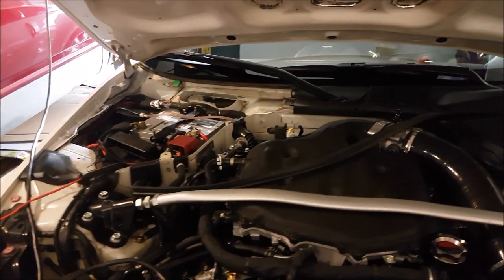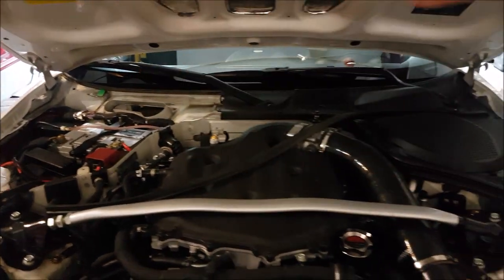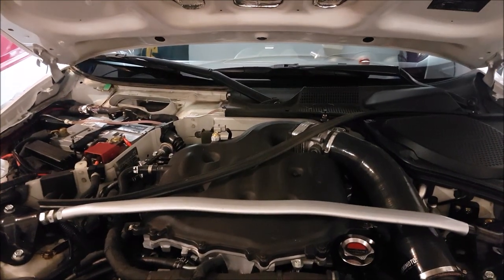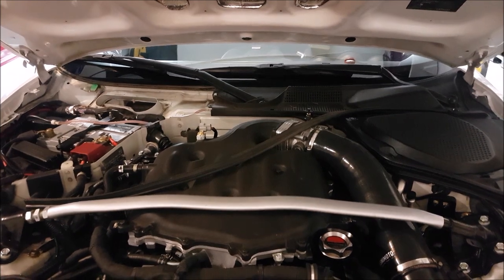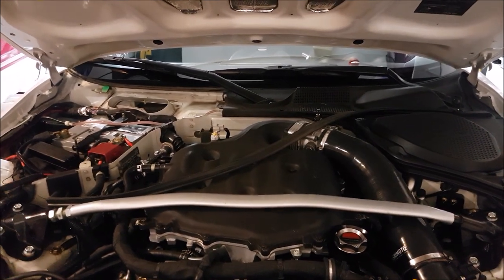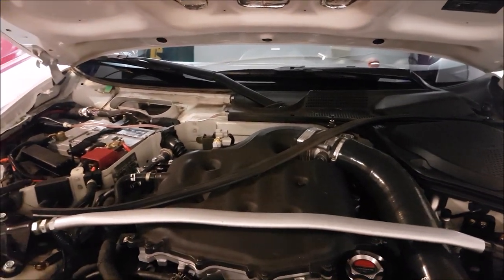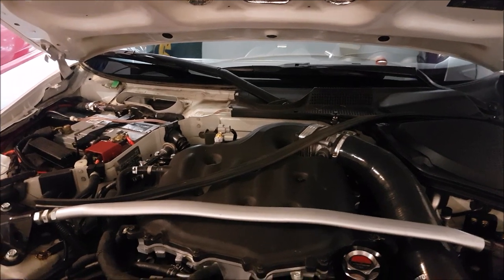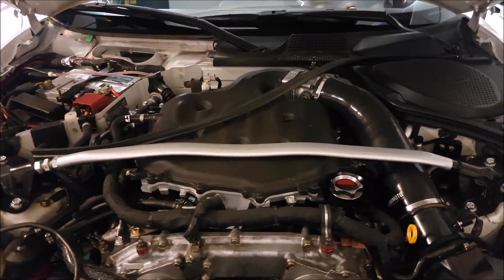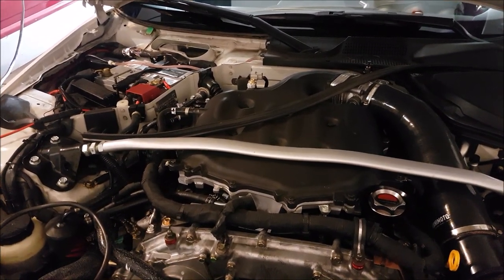In another video, we did an elaborate grounding system for our 350Z. We actually ran ground from the battery through the factory boot and did a perimeter around the vehicle. The objective was to remove any ground loops by connecting everything everywhere we could, so if there's a difference in sheet metal or a poor weld somewhere, we bypass that and rely on the copper. I was actually surprised — I've had so many people complain about AM reception, and I just happened to be driving my car in a different city, and I just couldn't believe how crystal clear it was. I really attribute that to how well this car has been grounded.